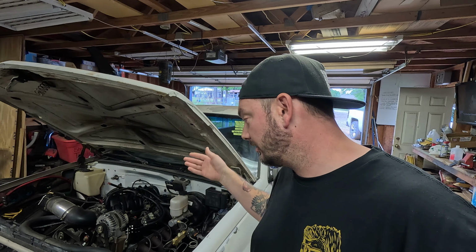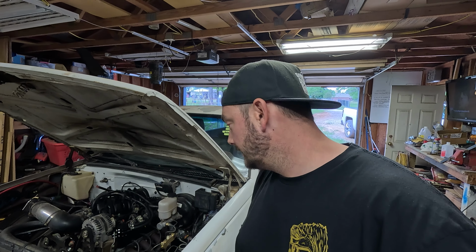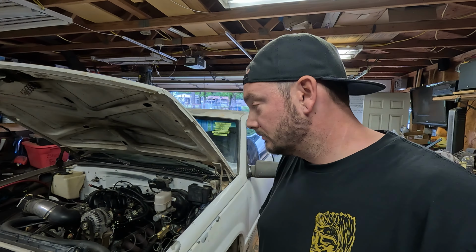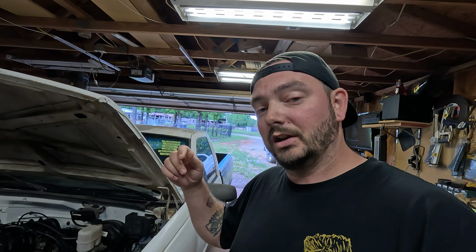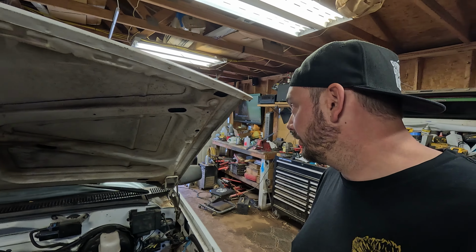As y'all saw a few videos ago, we fired up the truck. The engine ran smooth. It was quiet. Didn't make any noise, made great oil pressure, and the wideband was reading kind of where we need to be. It wasn't stumbling, it idled fine. It just, if you gave it any throttle, it would take the throttle, it would run up in RPM smooth, but as soon as you let go or you tried to lightly let off the throttle to get it back down to idle, it wouldn't do that, it would just die. And then we put it in gear, forward and reverse, and it moved, so everything seems kosher. The only thing that changed is I changed all the fuel lines, which y'all saw a couple videos ago.